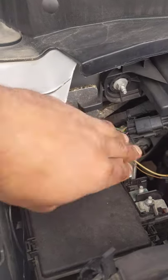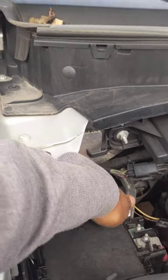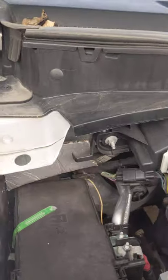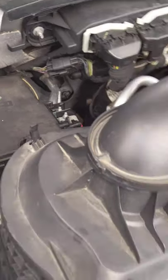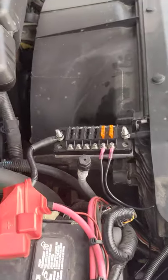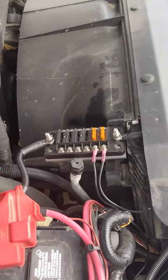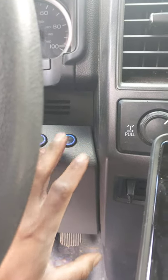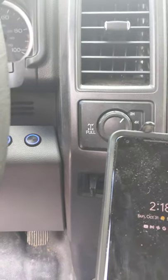Here they are on the top side. As you can see, we tied them up here. We're going to tuck them in the back behind the fuse box — tucked away so you cannot see them. We also added a little fuse block to install lights, and we put buttons here inside the truck because we do not have upfitter switches on this truck.